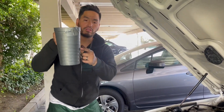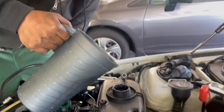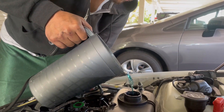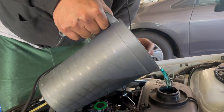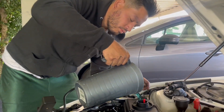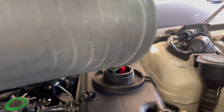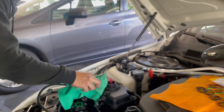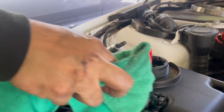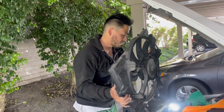Here's the old O-ring. I already put a new O-ring on — now we're going to put the coolant back in. I also opened the bleed screw up a little bit to let some air out. There's our red level indicator, and we are back to full again. We're ready to put the radiator fan back on.